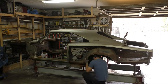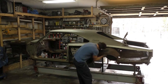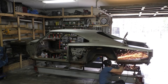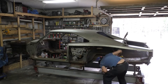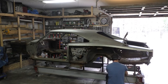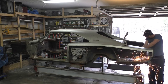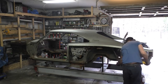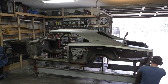You can see we got the outer wheelhouse off. I'm working my way on the rear trunk pan and trunk extension. This Charger has basically a shackle mount off the main frame rail — we are replacing that. I want to take a lot of measurements and verify that this car is straight. I'm cutting around all the frame sections in here to be able to access my air chisel and cut those off. We'll take our frame measurements, then remove our small frame sections and verify everything's back straight when we weld it up.